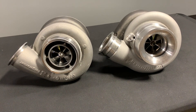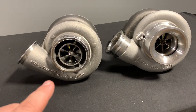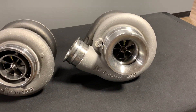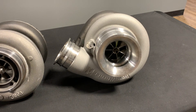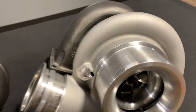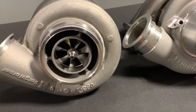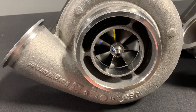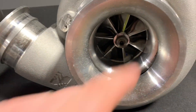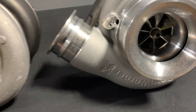Right off the bat, we can see there's quite a difference in the compressor cover of these turbos. The S400 uses a standard style compressor cover, whereas the S410SX uses a race style cover with an anti-surge ring. The cuff is much larger over the top where your rubber boot would go. You'll also notice we have a cast compressor wheel on the S400 — even though it kind of looks billet — versus a forged milled billet wheel on the S410, which also features extended tip technology.